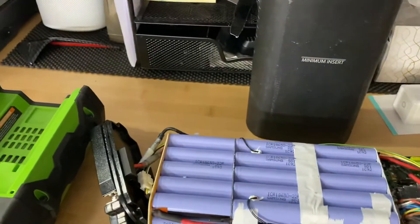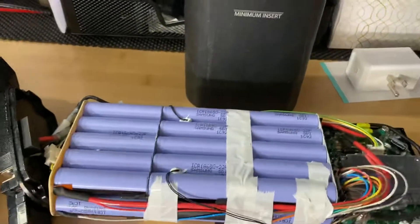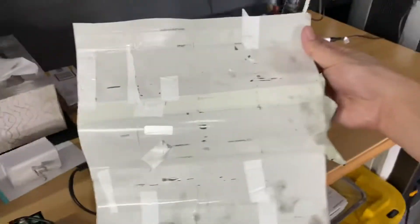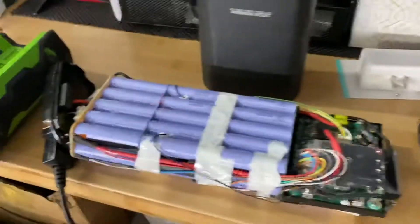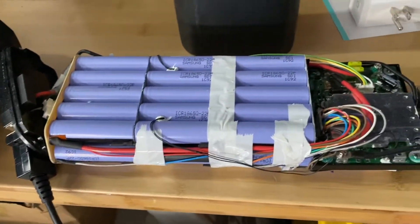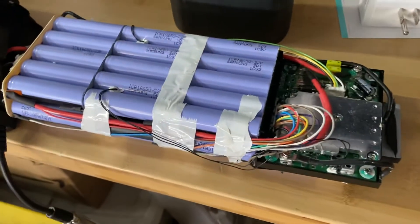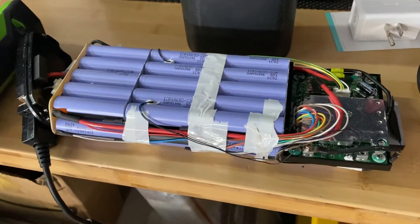Once you crank these open, all you have to do is keep tapping with a hammer, and eventually this whole unit will come off. The battery will be wrapped in this little thing here. The best way to test the battery is to take a voltmeter or multimeter and test the voltage on these. If your bike doesn't turn on, chances are that it's because of low voltage.